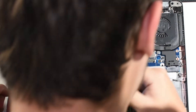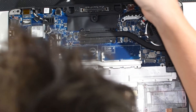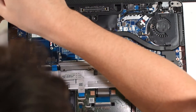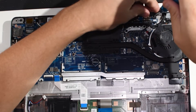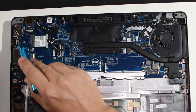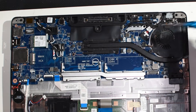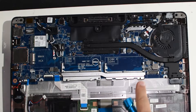We're also going to need to pull out this, this, this, and this, as well as this corner one in the back — which should be a long screw. Basically every screw that goes through the motherboard all the way is going to be a long screw, and these are short screws here since they go into the base of the keyboard and not actually into the motherboard itself.